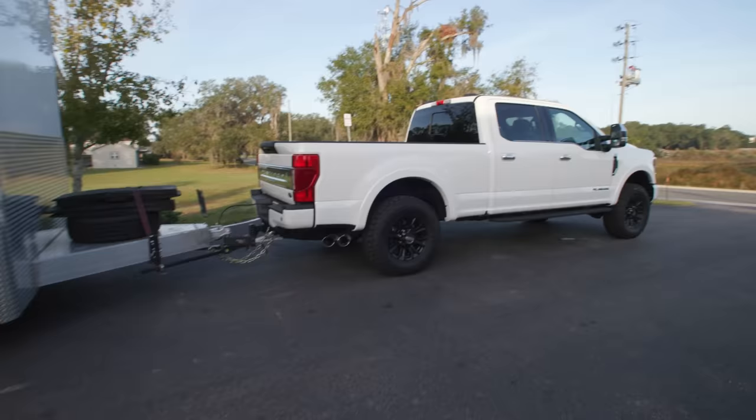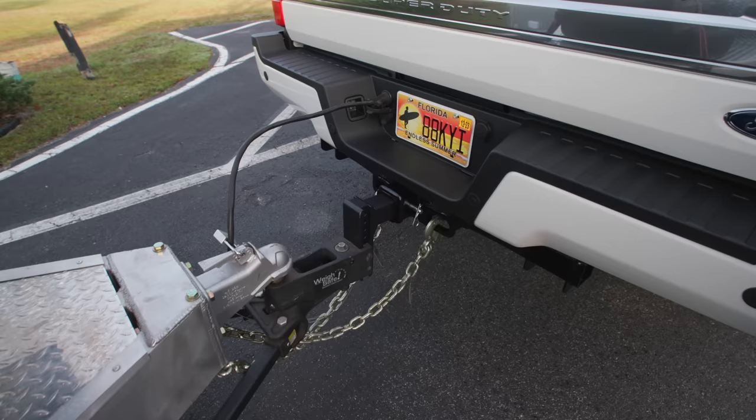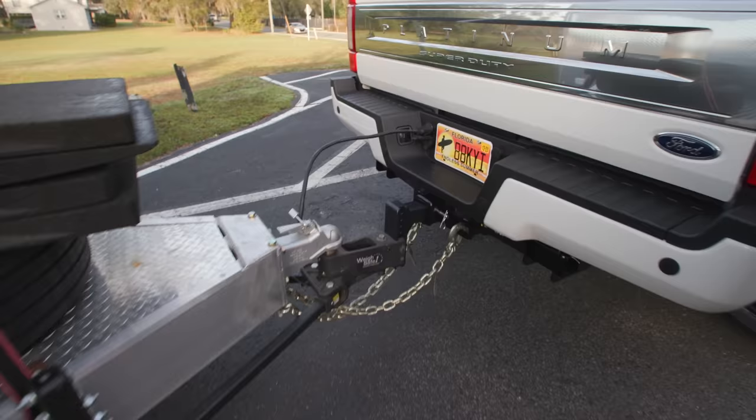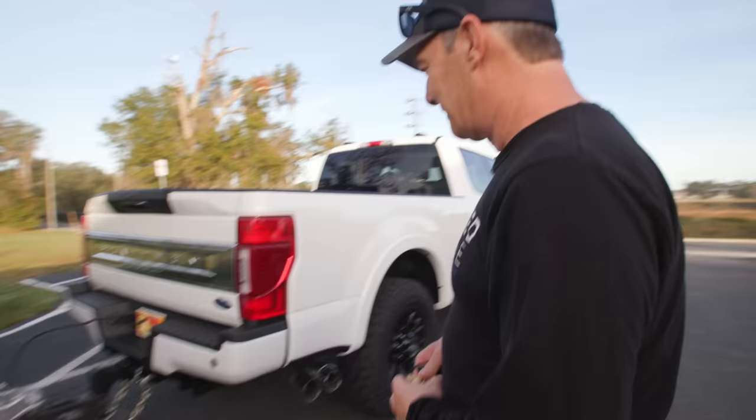Got our stacker, and I had to buy a new - the receiver on this truck's two and a half or three. The old truck was two inch, so I had to buy the new hitch part. The receiver's the truck. So anyway, I bought it two and a half inch. We got her preloaded - tongue weight's like 1,500 - I preloaded this to 3,100, which is what the app tells me to do. It tows nicely.